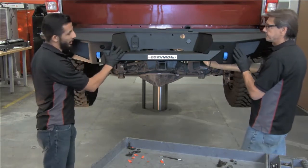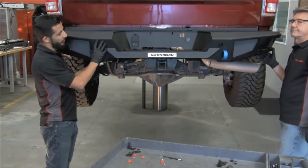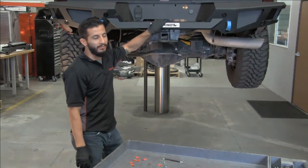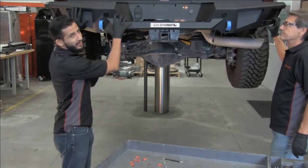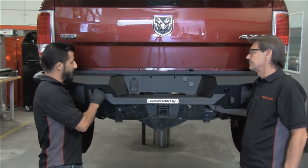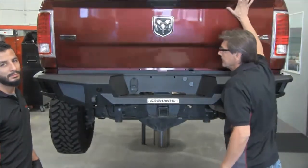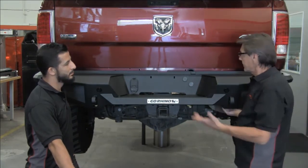Now we've got the bumper on — Pete assisting to put it back on. We're going to slide it over the D-ring hooks and then install the hardware: two half-inch bolts per side to fasten the bumper to the brackets and to the frame. The bumper is safely secured but not fully fastened yet so we can make final adjustments — checking clearances with the tailgate and ensuring the disc sits close to the vehicle for proper aesthetics. Confirm bumper alignment left to right and up and down, confirm the tailgate clears the top of the bumper and the back lip, then tighten the bracket bolts to factory specs and the specs specified in the instruction sheet.